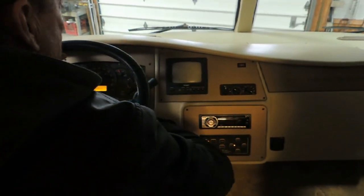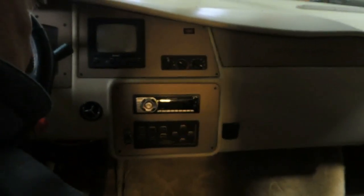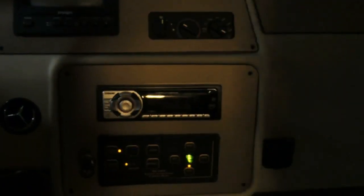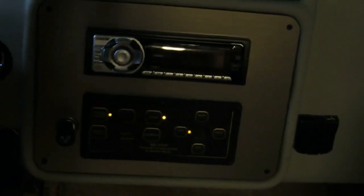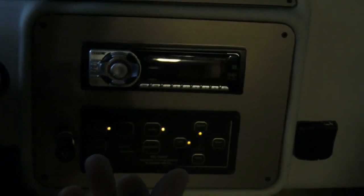Let's go over all the lights down below there. The key has to be off for the jacks to work. Turn the power button on and wait for it to do its thing. Once it starts flashing, hit auto and the light will come on beside auto. It's going to start leveling the unit — putting down the legs.